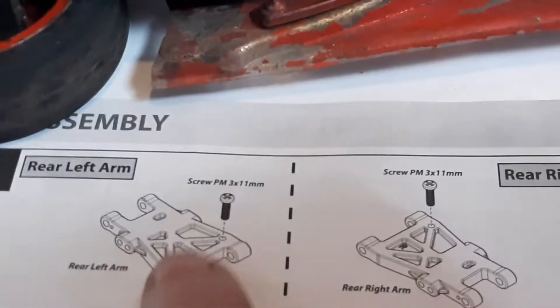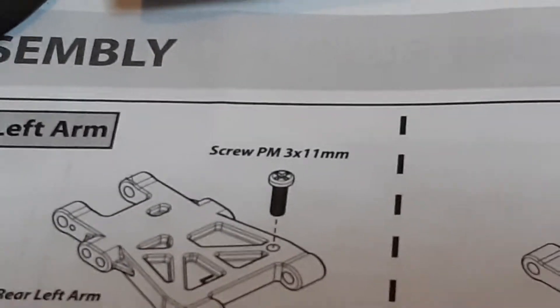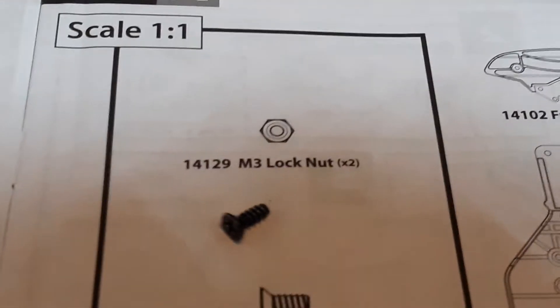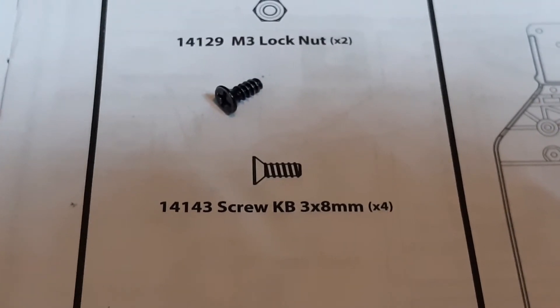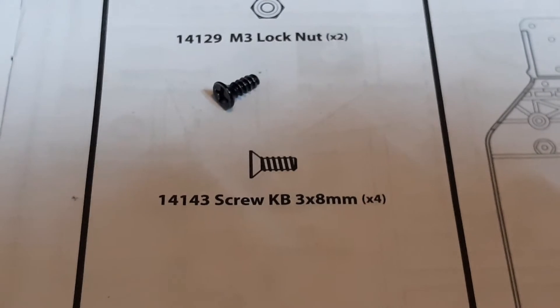The tapered seat is this little cone shape you see at the end of the screw — that means it sits flush on the bottom of the chassis. I'm going to turn this around; I took it out just for the video. So it's going to sit flush, just like the other ones. This screw here is flat on the bottom — that's a panhead screw, designed for something entirely different. So you'd take your missing screw — let's say it's the 3x8mm coarse thread tapered seat, which would sometimes be referred to as a wood screw.